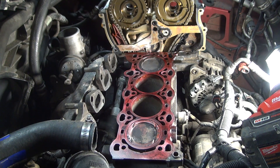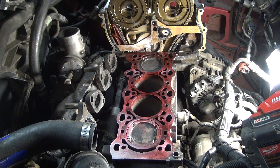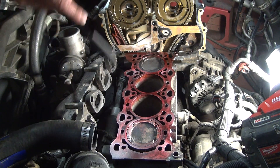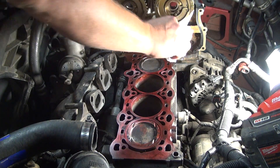One video explained it's not the correct way, and the guy really seemed like he knew what he was talking about. Some backyard mechanics were just taking the penetrant red dye and spraying it everywhere — it gets really messy. You don't need to do that. What I did was take a cheap foam brush, do one small spray of penetrant onto the brush, and that did the whole cylinder head. That's all you need.